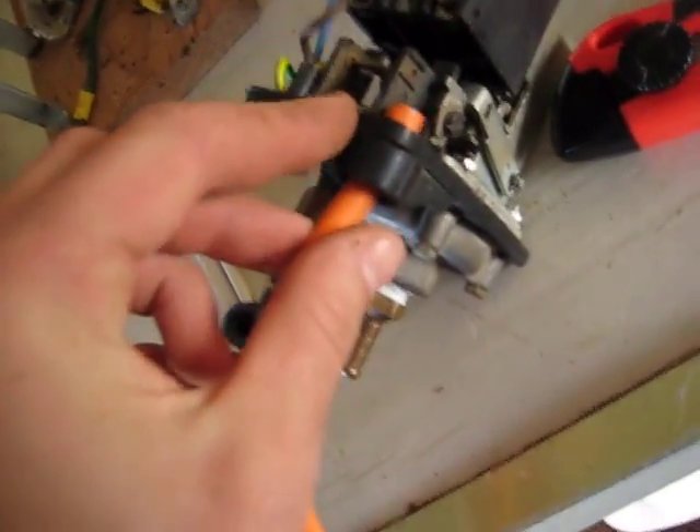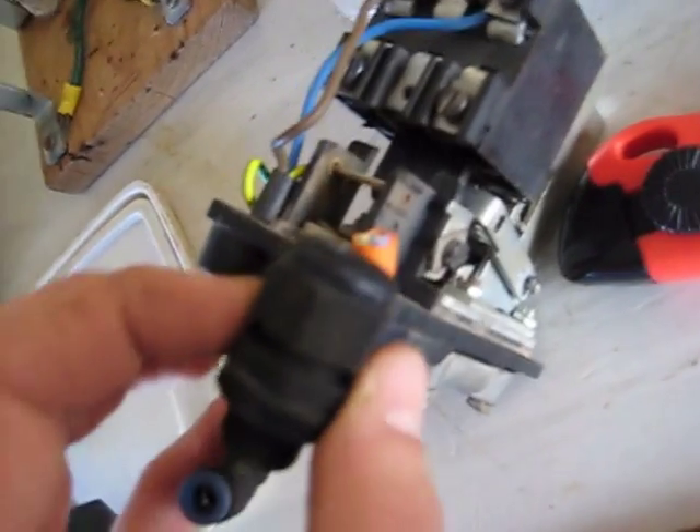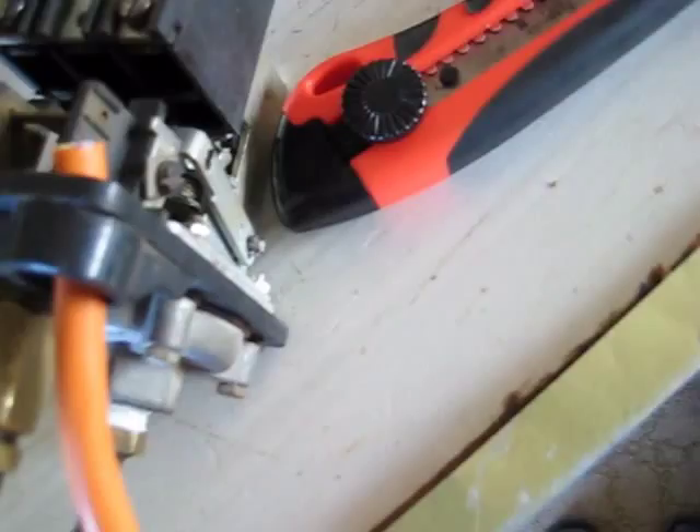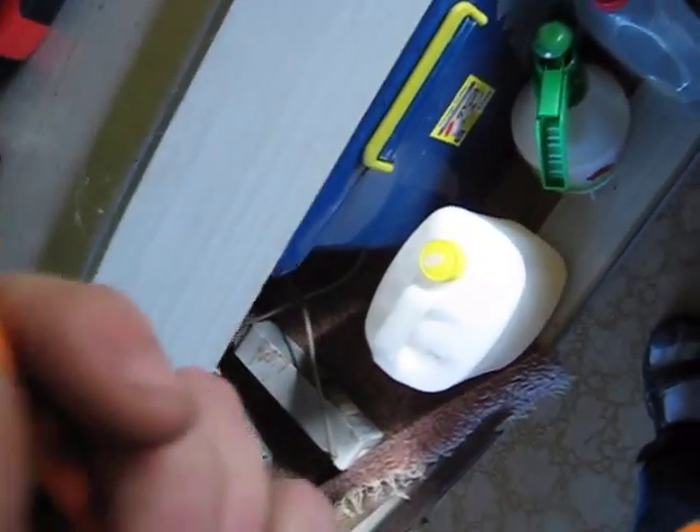Now, this is an old Italian brand switch contactor, but it's missing the cable holders. It's supposed to have these sorts of things that screw up in there, but they're supposed to be slightly smaller and they can taper and bite the cord, but I can't seem to find them. Anyway, I'll show you how to wire these contacts up and how to strip this cord.